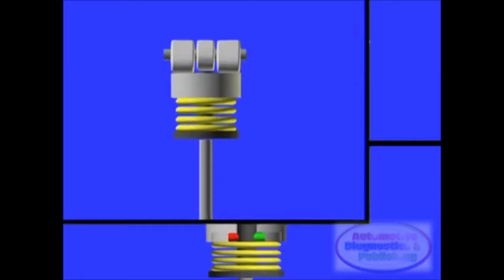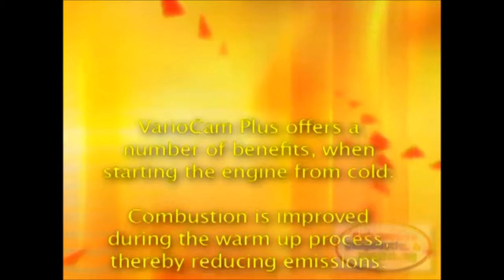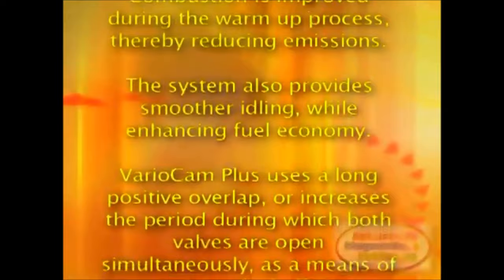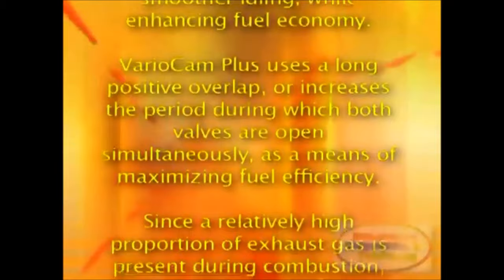Combustion is improved during the warm-up process, thereby reducing emissions. The system also provides smoother idling, while enhancing fuel economy. Variocam Plus uses a long positive overlap, or increases the period during which both valves are open simultaneously, as a means of maximizing fuel efficiency. Since a relatively high proportion of exhaust gas is present during combustion, there is also a significant reduction in NOx